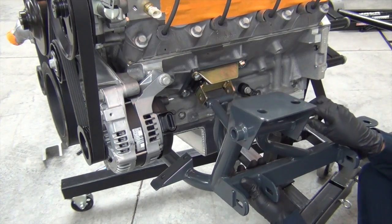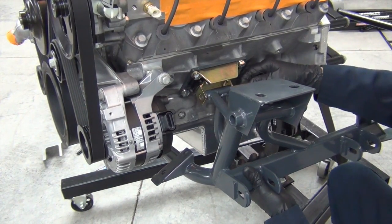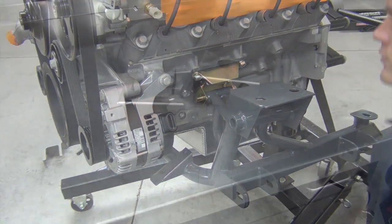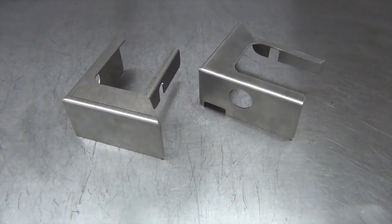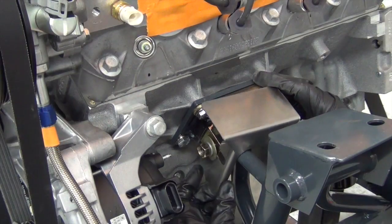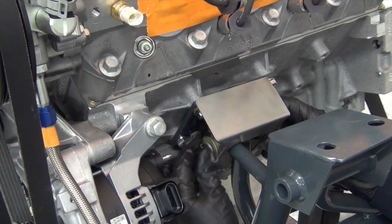In the last episode, we installed our new oil pan, so now it's time to reinstall our V8 Roadster subframe and bolt it in place. To protect our polyurethane motor mounts, I picked up these heat shields from Flying Miata. They slide right in before bolting down the motor mounts for good.